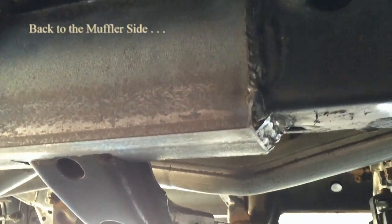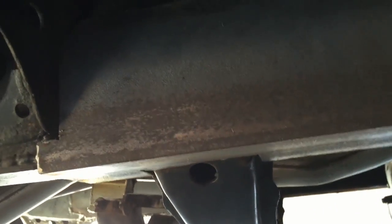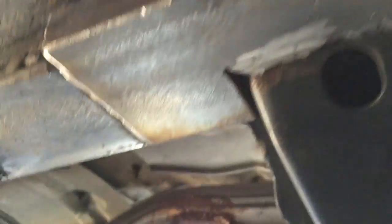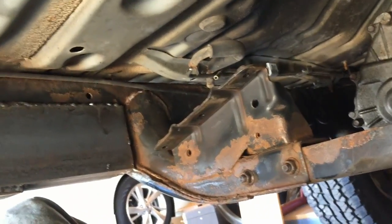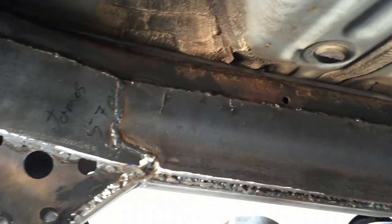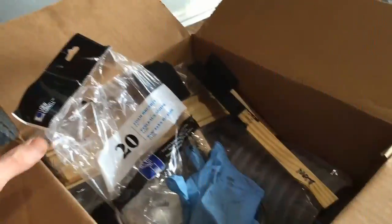Right here is a new piece I just added. The reason I added this was that right at this crossmember there was a little bit of rust causing some concern, and the crossmember looked like it was starting to weaken. So I just put a piece of the 3-by-4 in there and welded it up right against the frame.